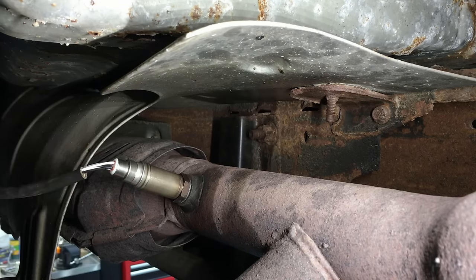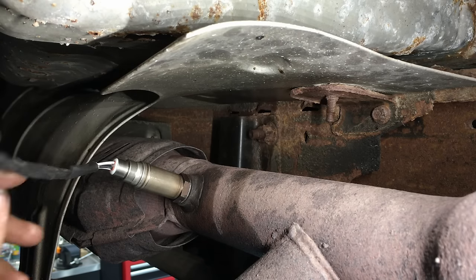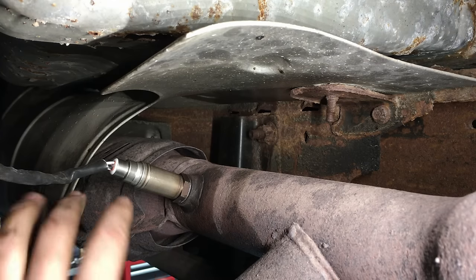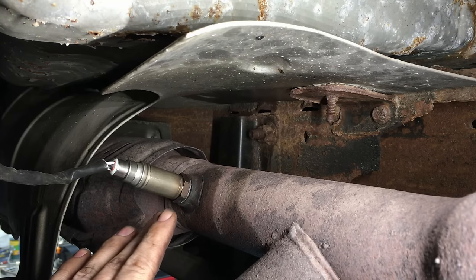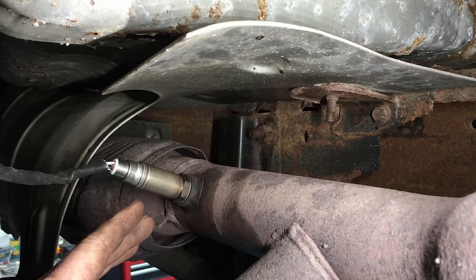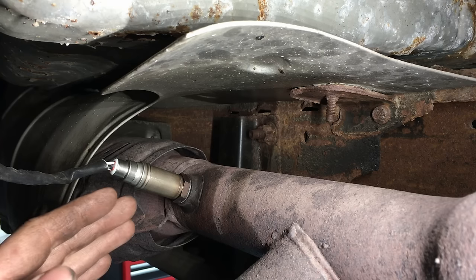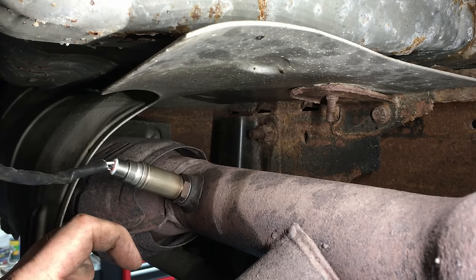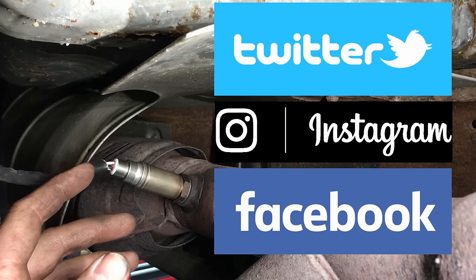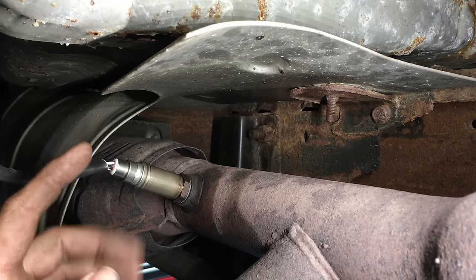Then of course, take the connector and plug it back into the body main harness until it clicks. Make sure your wire is out of the way and it's not going to rub on any hot exhaust components, and you are good to go. There you have it — after 20 years you're able to take the old one out and get the new one back in without any damage or problems, no mess, no fuss — just taking a few precautions. If you guys like this video, be sure to hit like and subscribe. We're also on Twitter, Instagram, and Facebook where I post tips and tricks about Ford-related stuff daily. I'll see you guys next time.